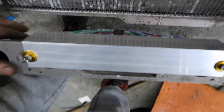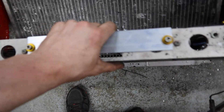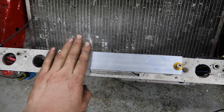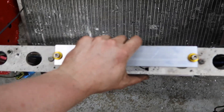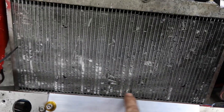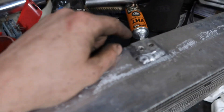I've just made this bracket here. I've got a bit of angle iron, drilled two holes, and I tapped the actual frame itself. I did have a bit cut out here for the original lock which I'm not going to use anymore. So this just adds to strength, and not only that, it'll actually become a bracket for the intercooler. It has two holes up here which are already threaded — I'm going to see if I can do something with that.